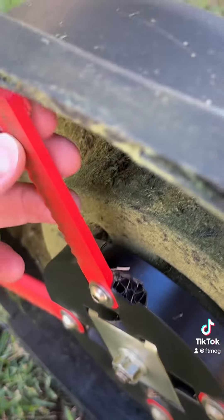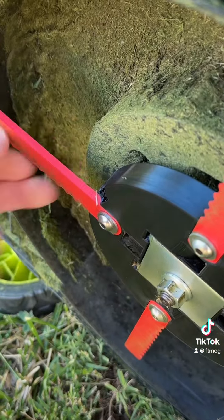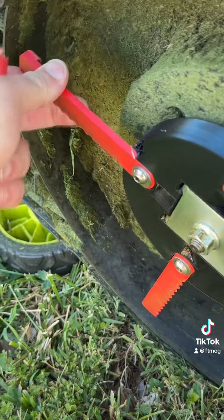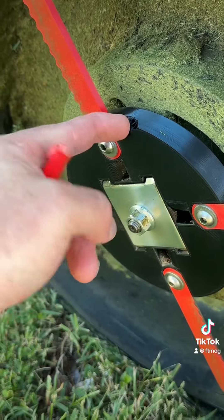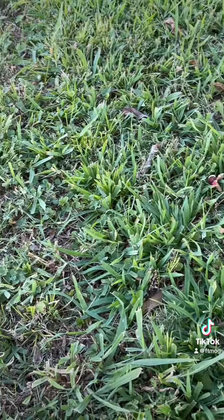It works freaking great — it mows amazing. But we do have a failure here. It looks like one of them — the piece on top that I was using as a stiffener broke. The old graphite piece, the arrow shaft, flew out somewhere. So we're going to make another set of blades that are just solid plastic — straight solid polycarbonate, probably 30-40% solid. I may have to make this piece out of polycarbonate as well. It must have hit something, or maybe that's just caused by the arrow shaft coming off and bouncing around in there. It definitely cuts really really nice though.